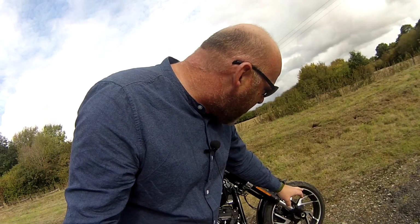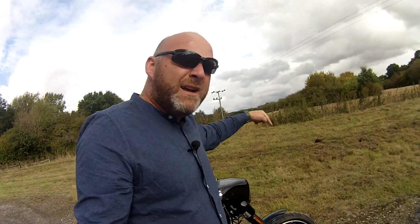The 63 means that it's 272 kilos max loading on this tyre. So basically right down there, that's the maximum for the tyre. Now obviously you're not going to stand two or three people on the front tyre and ride at, you know, 130 miles an hour, are you? Because the weight is distributed over the front and rear tyre. But essentially that's what it is.